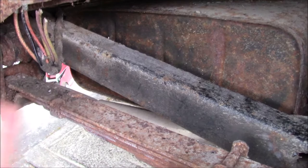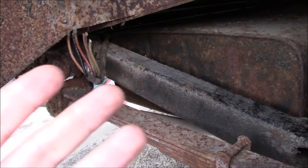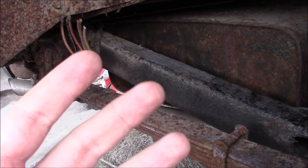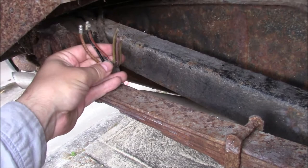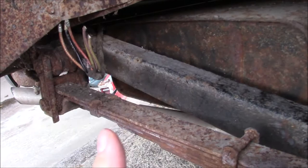So that long mystery wire — the full length of the car — actually goes through here. I thought there was just one length of wire in here, but there are actually two, and that's why we have that extra length. Presumably one goes up into the boot and may be for the number plate light, even though the colours don't match. That's one of the other frustrations — the colours on the wiring diagram, the colours on the new loom, and the colours on the old loom are not always the same. It's like having three different manuals in three different languages. I've been mostly ignoring the colours because it just confuses matters.